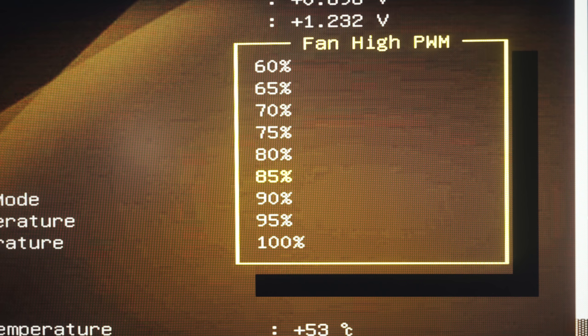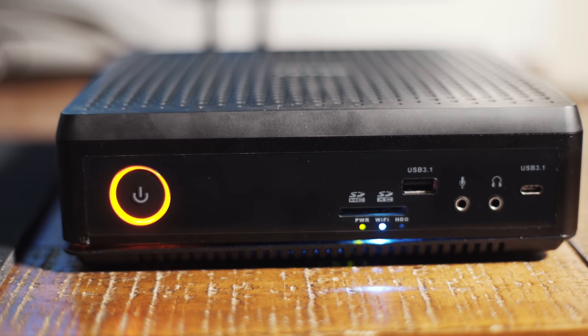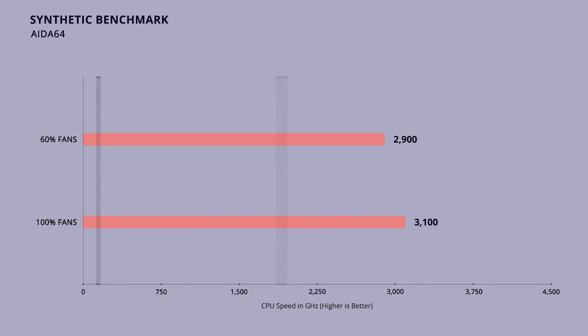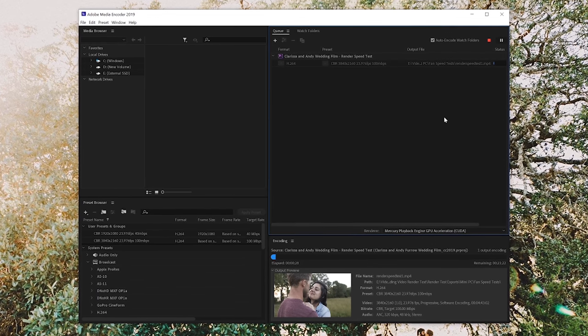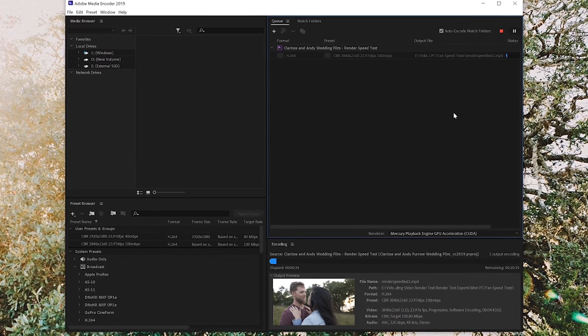Going back to the benchmarks — you may be thinking, what if we turn the fans up to 100%? Will the computer run faster, throttle less, and export videos faster? I tested this, and I don't think it's a good idea. Turning the fans to 100% makes them significantly louder and they ramp up constantly, so even while scrubbing your timeline you can hear them — it's annoying. With the fans cranked to 100%, I was only ever seeing, at most, a 200 MHz improvement. Render times dropped a negligible amount: from 18 minutes 34 seconds to 18 minutes 10 seconds for 4K, and from 5 minutes 45 seconds to 5 minutes 26 seconds for 1080p. That is not nearly enough of a performance increase to justify the noise.